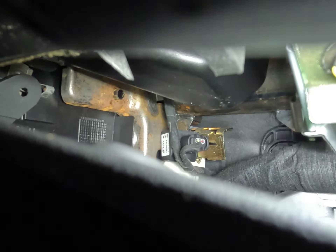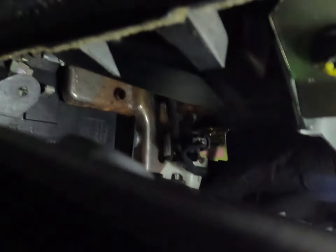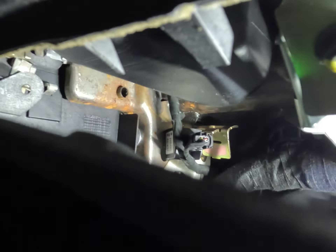I just went for a 20-minute test drive. We've got other codes in other modules, but we're not worried about any of that at the minute. What we found with this sensor is we found damaged solder joints internal to the sensor. If you're wondering why the glove box is dangling like that, it's because the actuator's busted on that door, so I couldn't actually get that door open to get into this sensor. We had to sort of wiggle our way in here. If you can see there, I've got that sensor just sitting up there — that's your longitudinal acceleration sensor on these.